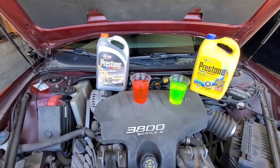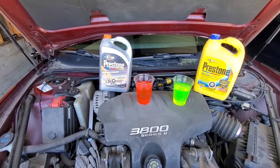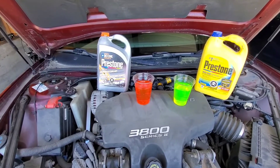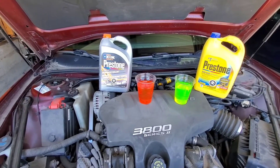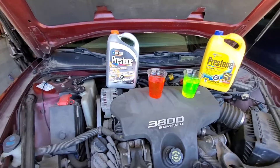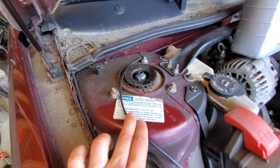If it's been designed for Ethylene Glycol, stick to Ethylene Glycol. I don't recommend trying to drain out the system — for example, one that is Dexcool — and then going to Ethylene Glycol, or vice versa. The reason is your car was designed for this specific coolant, for the characteristics of that coolant. We see here: use Dexcool only.